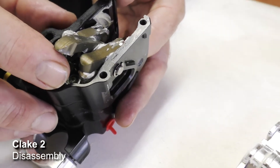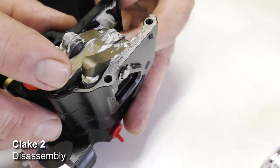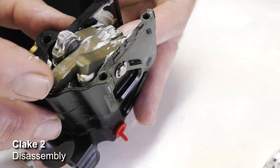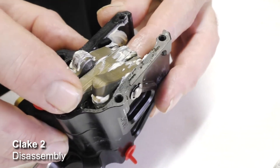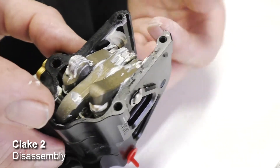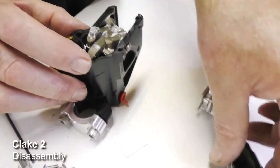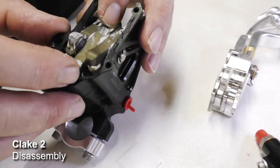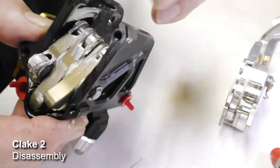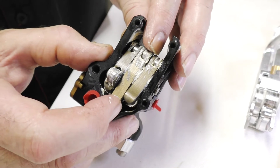This pin here is the clutch actuating pin, and this is a clutch rocker. It's very important to make sure that when you reassemble it, they're properly connected - see how that's lifted out there? Make sure that it's in place before putting the lever set back on. Once the slave cylinder or end housing backing plate is on, it can't come off. But while it's off, it can jump out of position, so it's very important to make sure it stays in position.